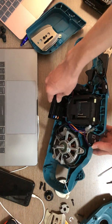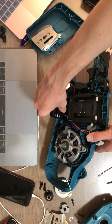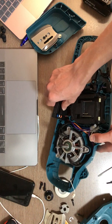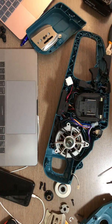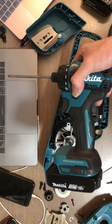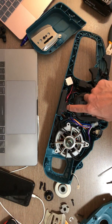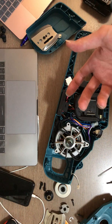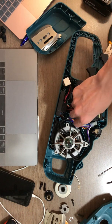Yeah, this saw, the motor actually eats a lot, so they put a heat sink on the circuit board. It's really very rare in power tools, because I analyzed many power tools, whatever screwdriver, the chop saw and the circular saw, they won't add this heat sink. That means this motor is really going to draw a big current. That's why the MOSFET has to use an extra heat sink to cool down.